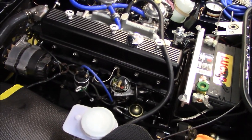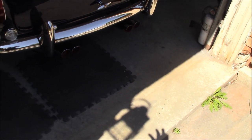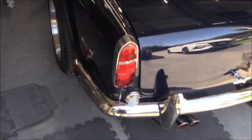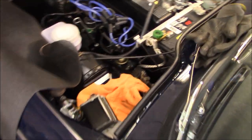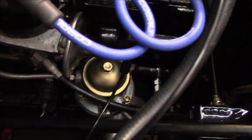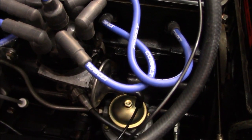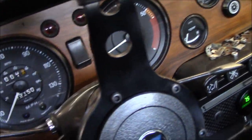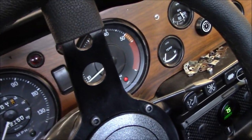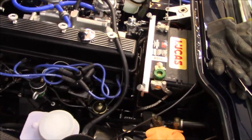The car is back up and running with the newly moved distributor gear. It sounds good - I've tested it with the vacuum gauge and we're getting about 16 to 17 inches of mercury. Here's what the tach cable looks like now in the correct position with the distributor moved. We've got about just over 1,000 RPM on the gauge; I could probably lower the idle a tiny bit, but these cams like to idle a little bit higher, so I'm happy with that.